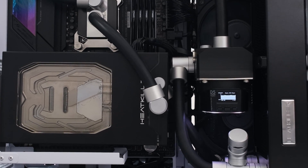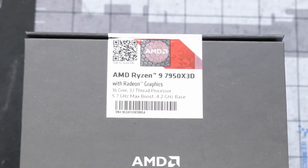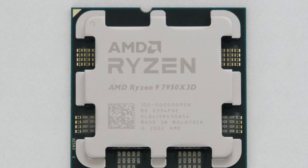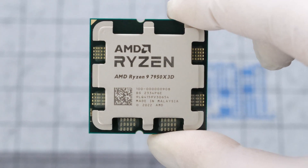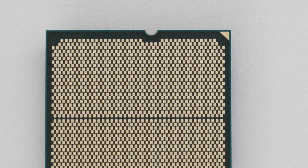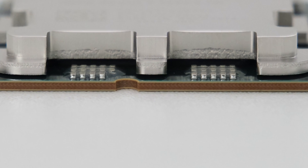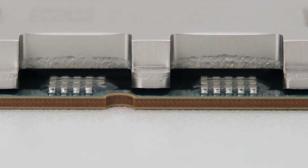This is the Vector Network. We will build around a 16-core AMD Ryzen 9 7950X3D AM5 CPU. Its high core count can be utilized by many productivity tools for a noticeable performance boost, and these are the most cores currently available from AMD outside of their Threadripper series. The 3D V-Cache version has a lower base clock and operates at a lower power level of 120 watts, which translates to some editing tasks being slightly slower. The trade-off is a boost to gaming performance, making it the balanced choice for an editing and gaming rig.